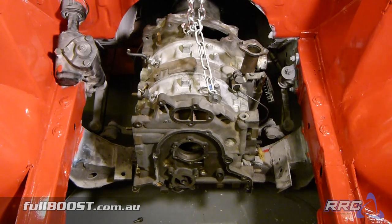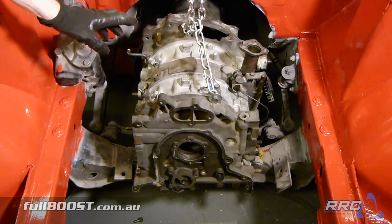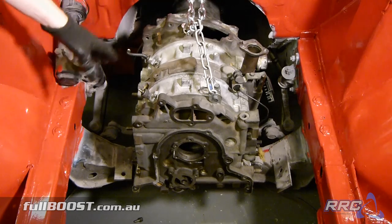We're not actually going to use any of those methods. As this is set up for drag racing, we want the engine to be as rigid as possible — it's going to be solid mounted. So we don't have to worry about large bulky engine mounts; it's just going to be solid mounted direct to the cross-member.